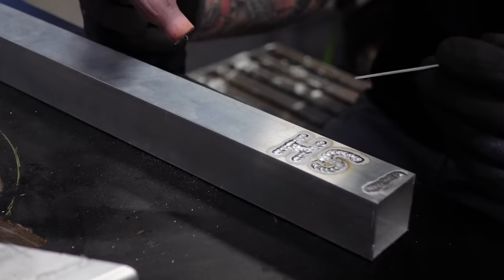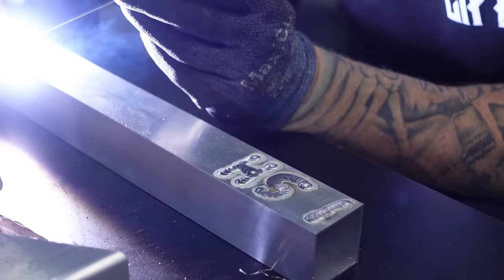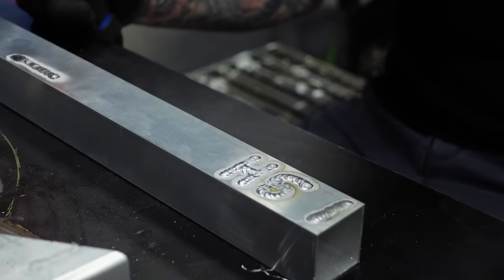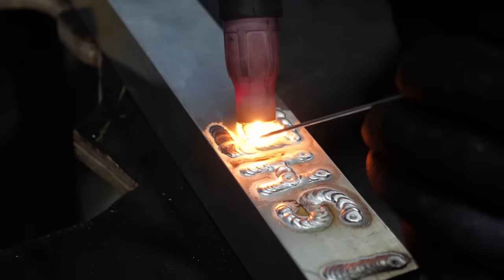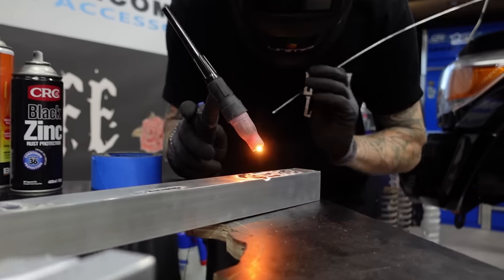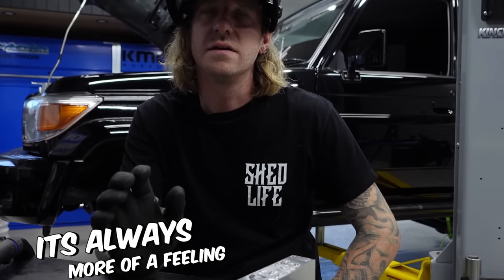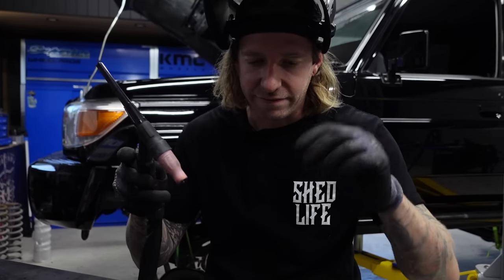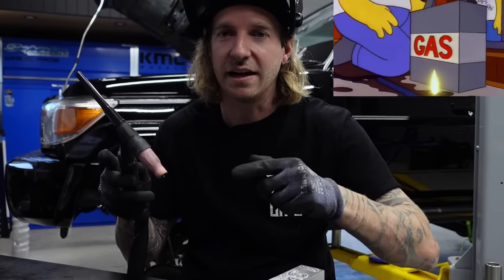Alright, I guess it's my turn. I can see! I'll start over here so I don't ruin the shed. I see the contamination when you stop - push through. Get an adjustable dial one, guys, because it's all by feel. If the material's not starting to mirror up, you need more heat. If it's mirroring up and pooling real bad and undercutting, you've got too much heat.